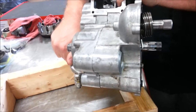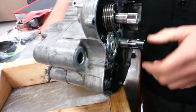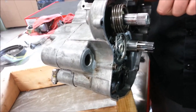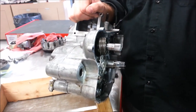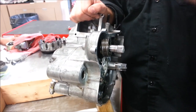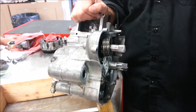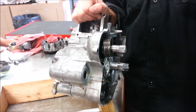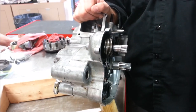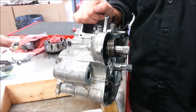I'm going to shift again, but I might have to rotate that a little bit. Why am I having to rotate the shaft a little bit? Our engines are not meant to be able to go from first to fifth gear like you can with a car transmission — you can take those and shift into any gear. We have to go through the gears to get to the next one. We have to do first, go into second, third, fourth, fifth, sixth. We can't skip a gear.